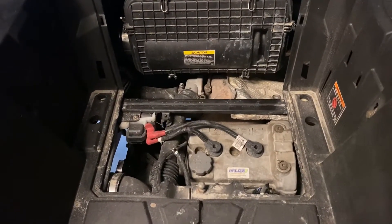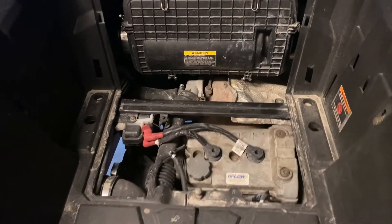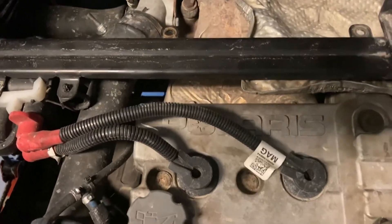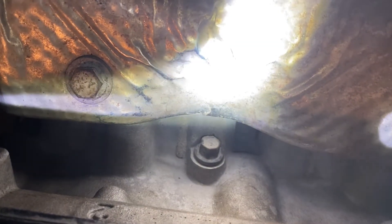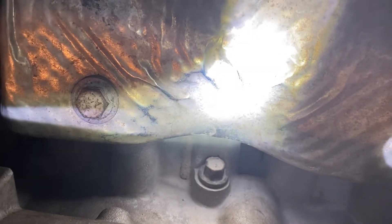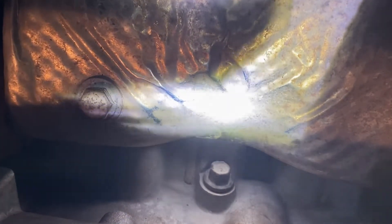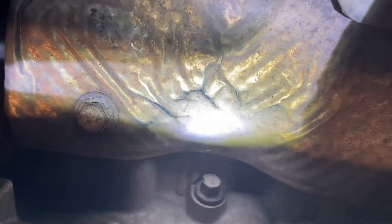The machine is still pretty warm but I'm going to show you where the bleeder bolt is on the motor. It's in the same spot on the Turbos and the 1000s, but with the turbo in the way you have to go from the top through the engine compartment — you can't go through the little peephole between the seats. It's an 8mm bolt. All you do is break it loose a couple of turns and wait until you get a steady stream of coolant out of that bolt, then tighten it back up and run the machine. Keep doing that and top off your coolant until you get a steady stream — that'll eliminate any air pockets in the motor and prevent overheating.